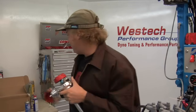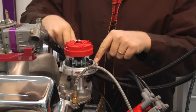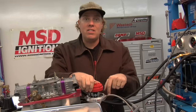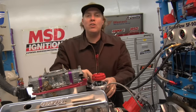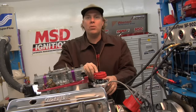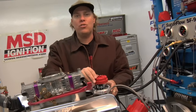And of course, we're assuming you have eight cylinders — as you should. Now, you can see this one installed in the engine. The shaft won't turn because it is meshed with the camshaft inside the motor, but the housing will rotate independently of the shaft. That's the setting we need to get correct in order to align the rotor with the number one spark plug terminal, which is what you're going to learn when we show you how to actually install the distributor.